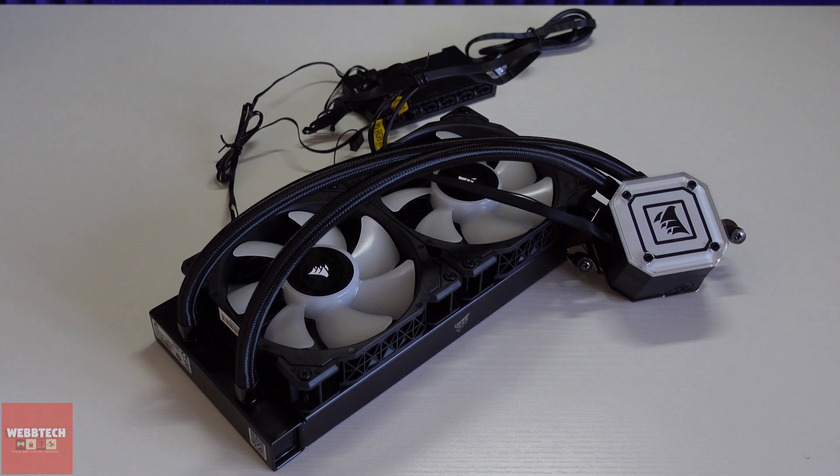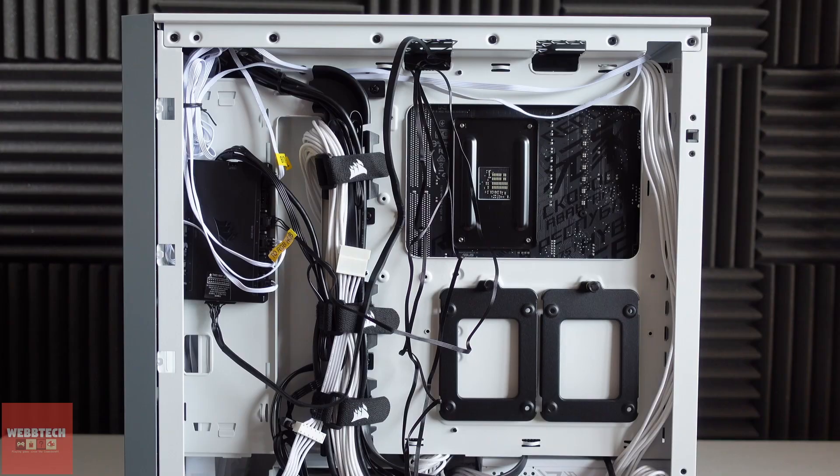With the Capelix it's a little bit more tricky. The interface cable is built in, which is fantastic — that goes to a fan hub, which is included. The fan hub has got the interface cable which then goes to the motherboard. The tricky bit is the cable management because the RGB fans take two cables and you've got to route them to the hub. It can be a bit of a pain and it's a bit messy as well because the cables aren't the most pliable — it's a bit fiddly. So from an installation point of view, the RGB Pro XT is far easier to install, so it wins this category.